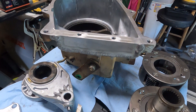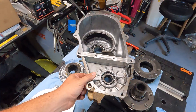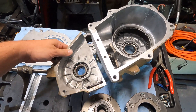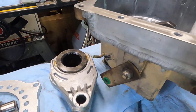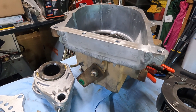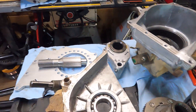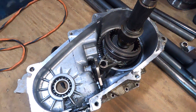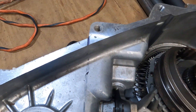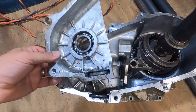As you can see, that plate has already been welded on. So typically your case would look like this minus the plate. I've already cut that section off — had a buddy of mine weld up the plate and he did an awesome job. Not worried about it leaking. I have seen where people put JB weld on it to seal it up that way — it works, but I don't think it's going to be as strong as this method. You can kind of picture that half of your T-case, where I put a Sharpie marker as a guide. I used a bandsaw, just chopped that right off — it cut like butter — and you end up with that section gone.